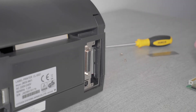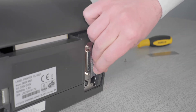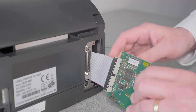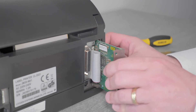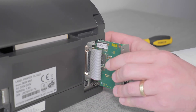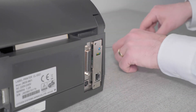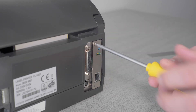If you're installing a card with the larger connector, first you must pull the connection cable out from the printer. The connector on the cable should be carefully aligned with the board using the notch. Once aligned, squeeze the connector home. Carefully fold the cable back in on itself and slide the interface card into the printer. Do not use too much force or you could damage the board. Both types of card simply screw back into the printer using the previously removed screws.